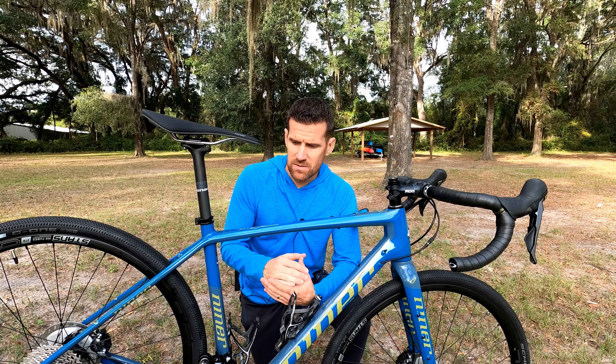Likewise, on the rear brake I pushed it in from the rear. You've got to do a little bit of fishing to get it around the bottom bracket and back into those holes, and they go all the way up through the down tube. No trying to fish cables through the frame — the days of fishing inner wire through a frame are behind us, at least for mountain and gravel bikes. It's full cable housing all the way through the frame, which makes it easy to run the cables and also easy to change the inner wire, which I typically do about every year or so.